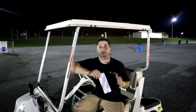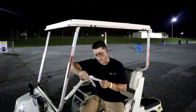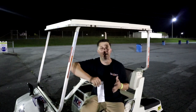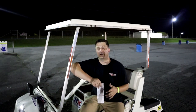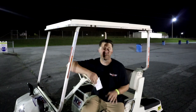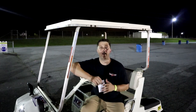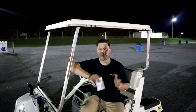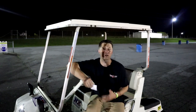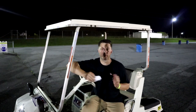Guys, so the third pass we did a lot better. We ended up cutting a 1.75 60 foot and we ran a 12.654. So 1.7 60 foot is the best we have had on the truck this entire summer. We have not been under a 1.8 60 foot ever. So we definitely went down. The track did suck a lot tonight. As you've seen, we were having some hit and miss passes big time. So definitely we're probably capable of running 1.6s on this converter, I would imagine, and that'll drop our time some more on top of that.